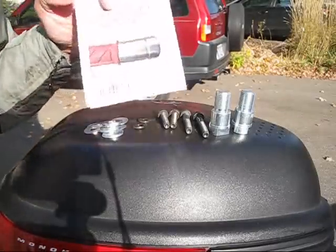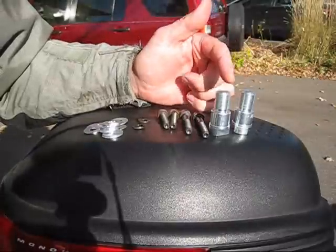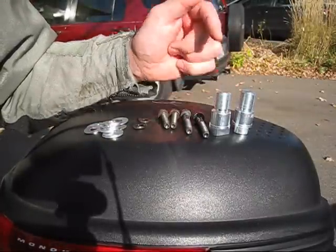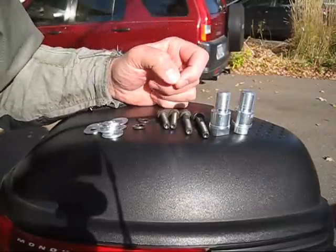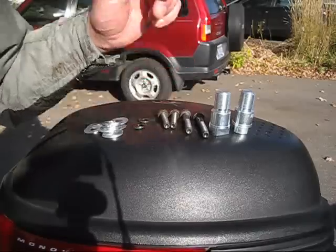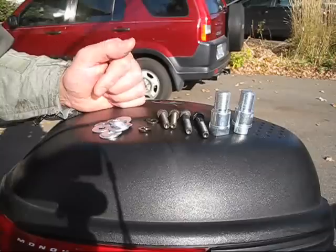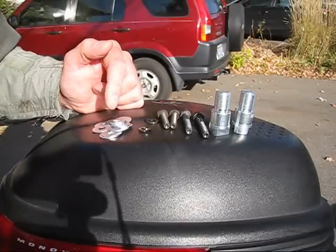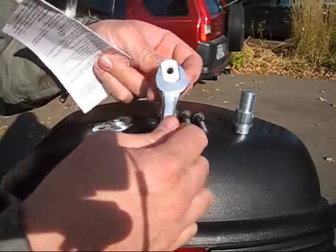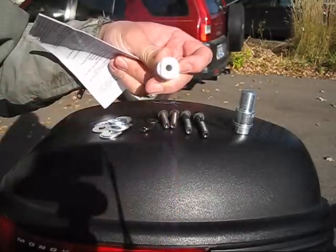Here's what you've got to work with. You've got the manual, which is specific to your bike. You've got a set of noses, which will screw into or around the big threads at the end of your handlebar. You've got two sizes of screw — depending on what you bought and what bike you have, different screws will be ideal. You've got a pair of lock washers, a bunch of shims, and the number of shims varies with the kind of bike you have. The noses typically screw onto the motorcycle with a 15mm wrench on their wrench flats, and the screws will end up screwing into the end of the nose.